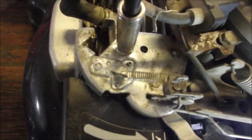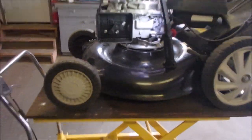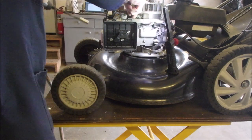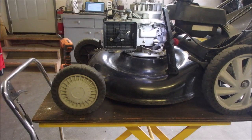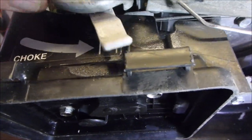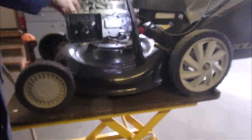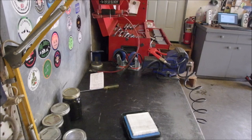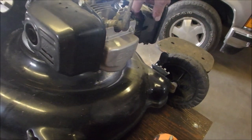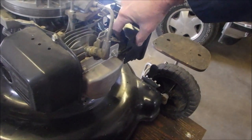Right here, there, and there — you can disconnect it. It's kind of a complicated little setup. And you have to check when you do something like this, you have to check and see what's rubbing. There's been a bit of rubbing going on right there. I'm just going to take this out and give it a good cleaning in here too, back over into where the shaft for the choke is — back in there.